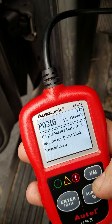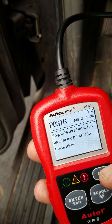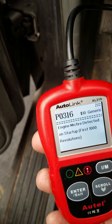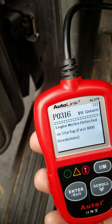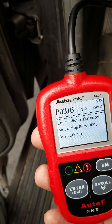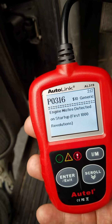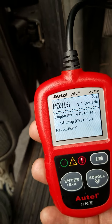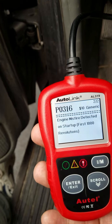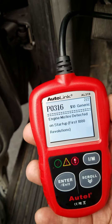In my experience, when you have a misfire happen and you give it gas and it goes away, it is usually too much fuel coming from the fuel injector, especially on startup. What happens is pressure stays on the injector when the car is shut off and it drips, loading the cylinder with gas. I have noticed that a couple times recently — I start up and run a little bit rough, give it gas a bunch of times, clear out that raw gasoline in the cylinder, and it clears up.